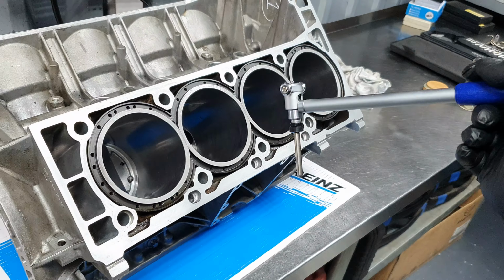I'm using this one just to measure all the pistons in the same position. You put it on the small hole in the center, push it fully down, and then put it on the micrometer to measure it, in a specific position every time. If you get your measurements, and then the measurements from the cylinder, you're going to see it makes sense. And if you do that, like I've said before, on an engine that's brand new, or on a 10,000, 20,000, 50,000, 100,000, 150,000, 200,000 kilometer engine, that means when you open the engine, you're not just throwing parts here and there, but you're gathering information. It's going to be very useful, especially if you're always dealing with this kind of engine.